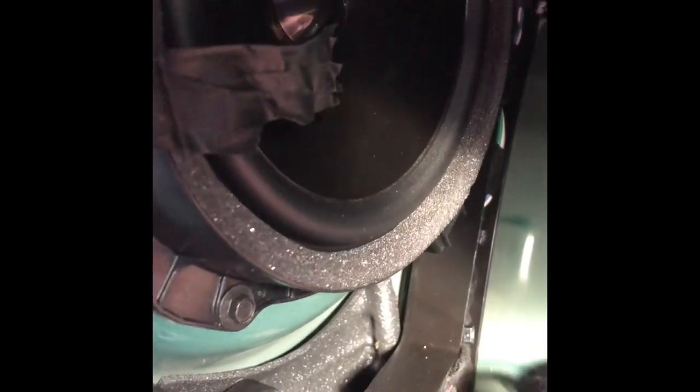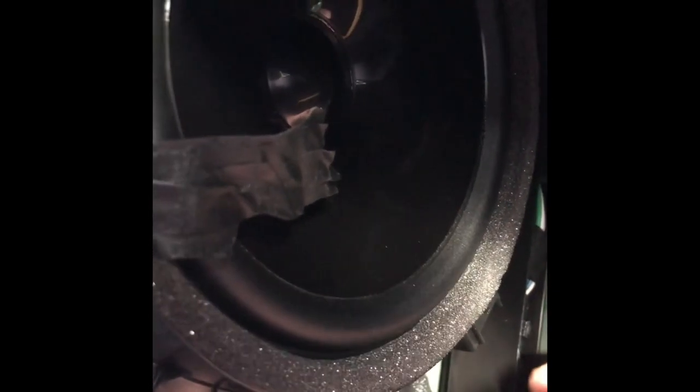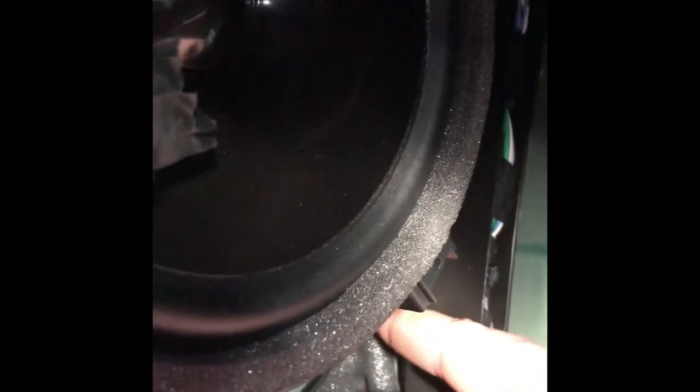When you replace these speakers, you'll notice there are four wires going into a two-wire setup. You can still use the same T-clip — just put the two positives together and the two grounds together and you should be fine. What I want to indicate here is this clip from Ford goes to the outside of the speaker box, but most aftermarket speakers are going to be behind the speaker box. By feeling around I found this little access port here — you'd miss it if you didn't look for it. I poked a hole on the passenger side, ran the wires through there, and wired everything up.